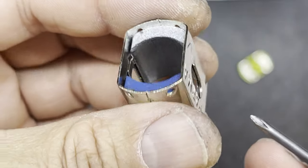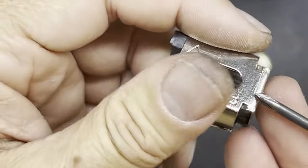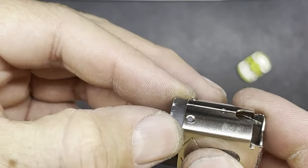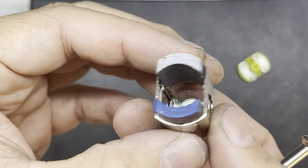If you watched the previous episode on my motor building when I took it all apart, you'll remember that the magnets in the can aren't actually glued in and they're not going to stay in the right position reliably during a race. So I'm going to need to glue them in.